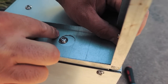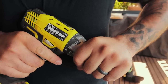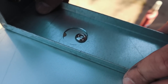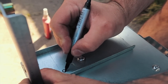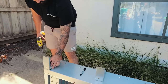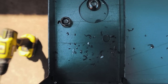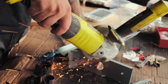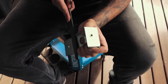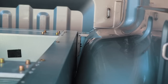I'm just going to have to elongate this hole a little bit because it just doesn't quite let the bracket be flush. These universal wing kits, obviously being universal, they do not match up at all. Just some simple modifications and we'll get it to fit. I'm going to have to modify the rear bracket to this wing panel — it's supposed to be universal but it has high wheel arches so the wing panel actually doesn't fit.